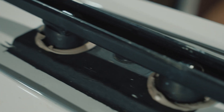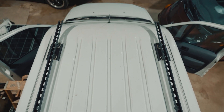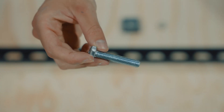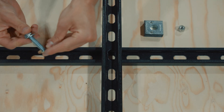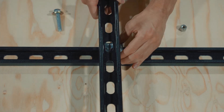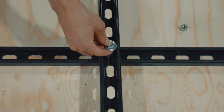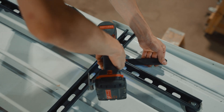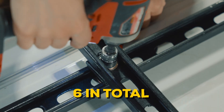I successfully moved the rails up, and now I'll show you how I'm mounting the crossbars. This is basically how it's going to go: a 3/8 bolt going through both the bars, a few washers on top, two of the square spacers in between both bars, another washer on the bottom, and a nylon lock nut at the bottom as well. I'm going to be doing the same thing for every crossbar — six crossbars in total.